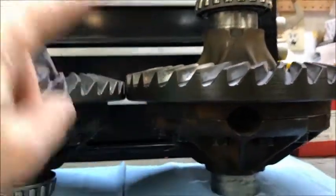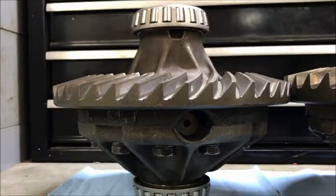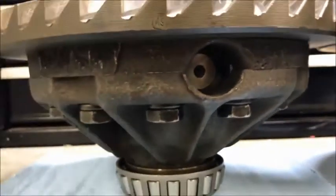The reason why this gets thicker is because the pinion gets fewer teeth than this guy. So more teeth means a larger diameter on the pinion. You have to move the whole ring gear over, and this is as far as you can go — otherwise you start getting into where your spider gears would normally mount.